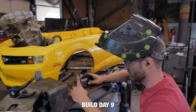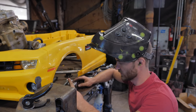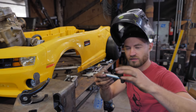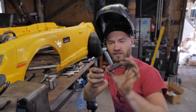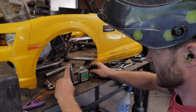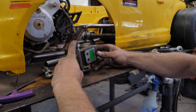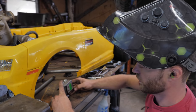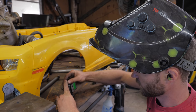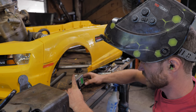So I came up with a solid plan for the front steering and suspension, now it's time to make it happen. I'm making the spindle pieces at an angle so that I can have some KPI. I zero it on the table and get 11.3 degrees of KPI, but I want a little bit more, so I'm going to break the tack and go to about 12 degrees.